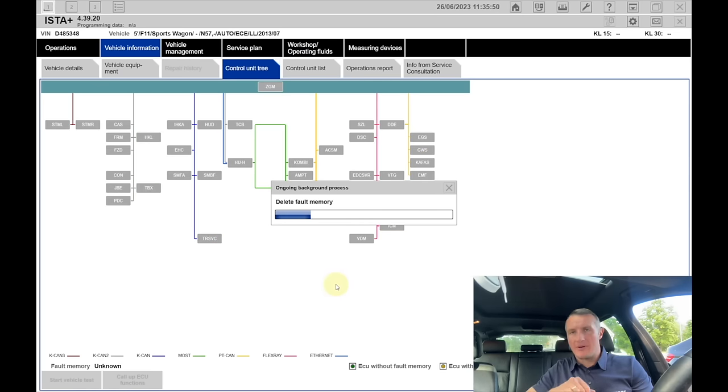In addition, remember I told you that we need to remove the fuses from the SCR ECU so it will not be visible. Of course we need to do that. Actually, about that I have created some time ago one YouTube shorts. I guess I put a link over here. So have a look. Over there I tell exactly what number of the fuse need to be removed. And of course, where to get the information, the ISTA will tell you what ECU is supplied through which fuses.